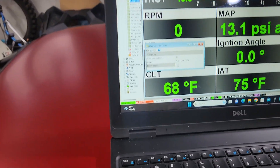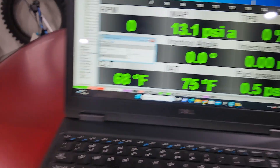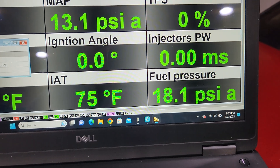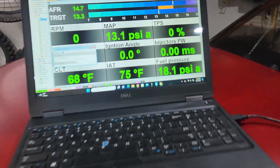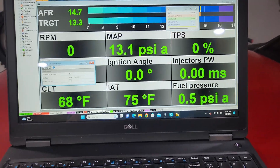The factory wiring still in the engine bay — don't worry about that; I'll eventually remove it. I tested it and it works: the pump runs by itself when I turn the key on. For kicks and giggles, I'll show you one more time. We're looking at fuel pressure here on the fuel pressure regulator — that's an AEM sensor wired up accordingly. I'm going to invert auxiliary one in the ECU software — you can see the fuel pressure holding pretty steady. You can hear it filling up. You can let it run like this because fuel returns to the tank, so you won't build excessive pressure.